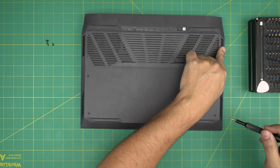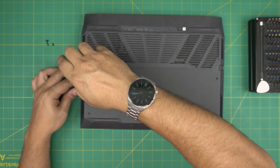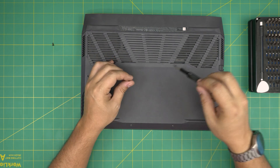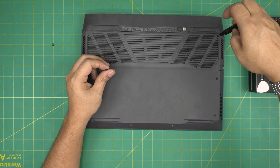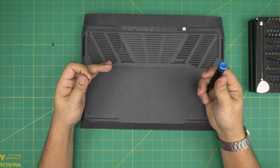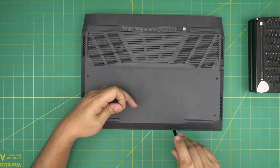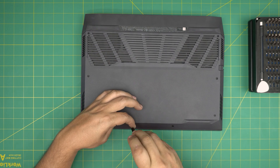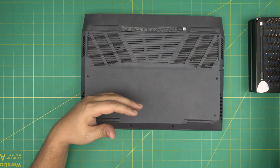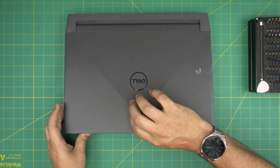If you see any opening just pinch it and it'll go into place. Regarding new batteries, it's very important: after installing, do not power on the laptop. Leave it off, connect the charger, and charge it for at least four to five hours. After that, power it on without the charger and discharge it slowly — put brightness down to 50 or 20 percent and let it drain down to 30–20 percent. Then power it off and charge again for four to seven hours. After that you can use it normally. That initial charge and discharge cycle is really crucial for new batteries.